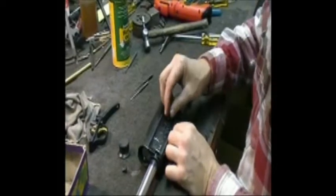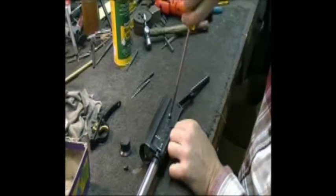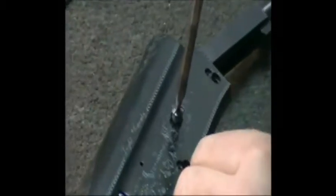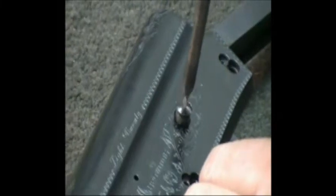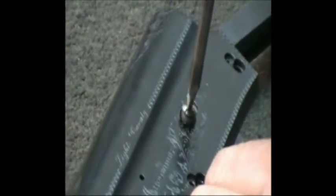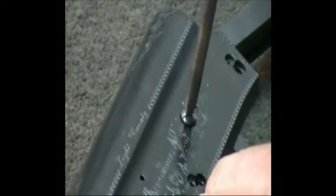You've got to put your carrier screws in. People ask if the screws are marked so you know which side they go on—they're not marked. You've got a 50-50 chance of getting it right. You just put one in, try it, and see how it indexes up. If it indexes right, you've got the right one. Of course I got this one wrong—no biggie, just pull it out and slide in the other one. I don't put my lock screws in until I finish everything.